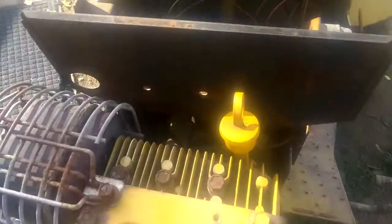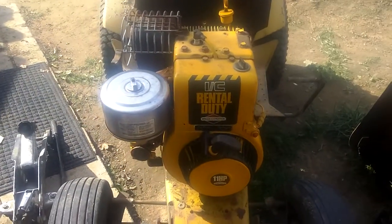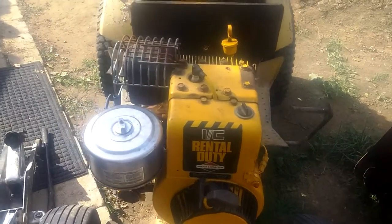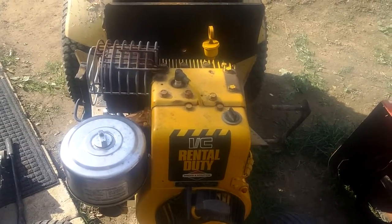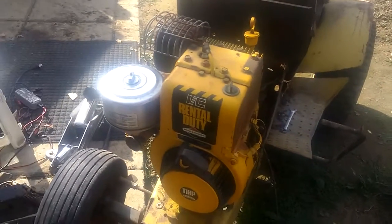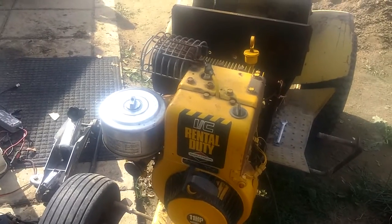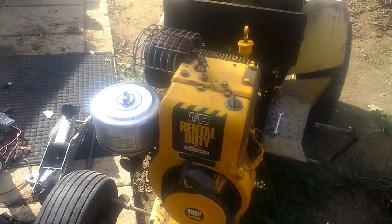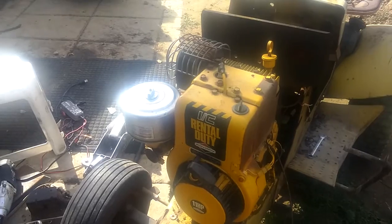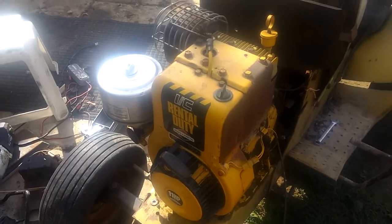That's what I'm doing right now. I did try using the puller to get that pulley off, but it just wouldn't move. With the flywheel upgrade, I'm going to be gaining a stator and potentially a starter. I'm not sure I'll have a starter for this or if this conversion is even going to work — I just want to see if it will, because it's going to bring this engine up to the next level, kind of like what I did with that 11-horse Tecumseh. I had another Tecumseh with electric start and a stator, and I actually got more money for that engine when I sold it. People want the electric start and people want the stator. Even if I can just get the stator in here and still have the pull start, that's still a big improvement.